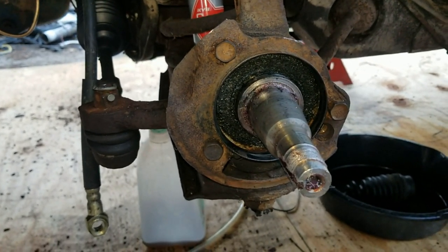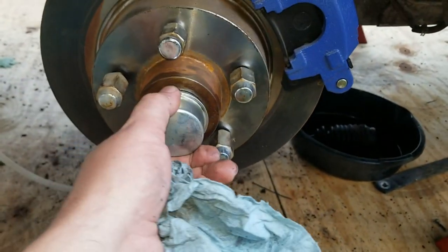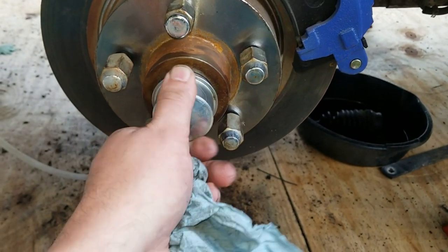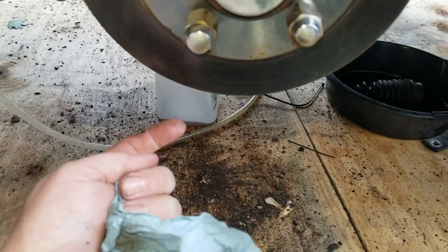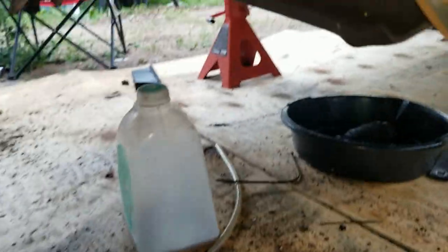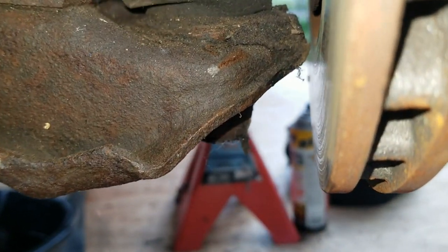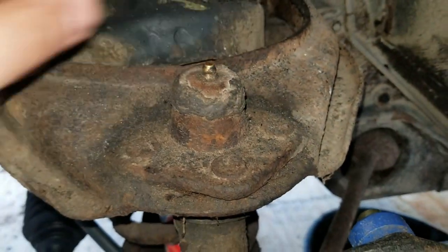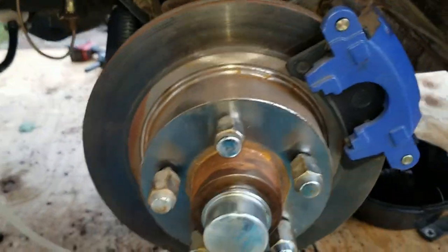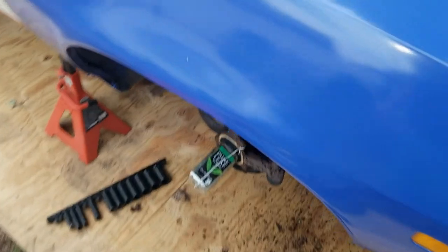Alright, looks like it was made that way — rust and patina all in the right spots. Didn't get a lot done this weekend. Got this side all put back together. I still have the nut to torque down and the cotter pin to put in, so don't let me forget. Brakes are hooked back up. Did a little hammer massaging on the lower control arm to get more clearance. New shock is in, new steering boot. I'm going to have to try to get some grease in here.